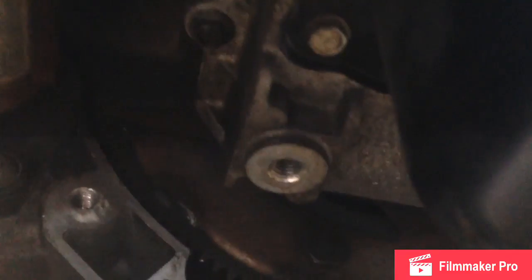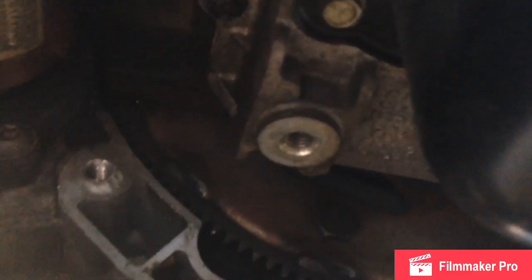You don't actually have to pull this thing all the way out to get the bracket out of the way. I just have it sitting on the last two bolts so that I can access all of the oil pan bolts.